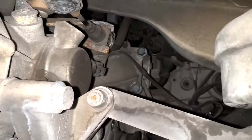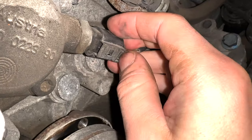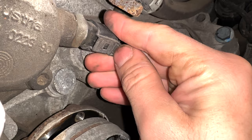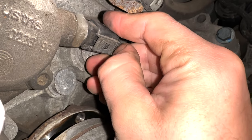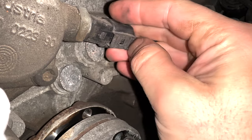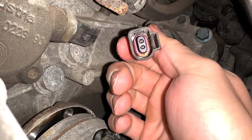Chapter 11: Disconnect the reverse sensor — the transmission reverse detection connector. On the 987.1 2006, the reverse light connector is on the passenger side. All I did was get my fingernail under it, lifted it. This creaked open after years of not using it. With my fingernail continually pressing, I just wiggled it, and it came right off. This is what it looks like on the inside.